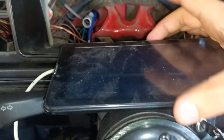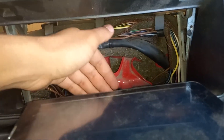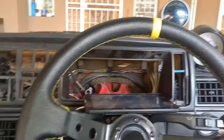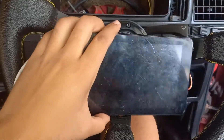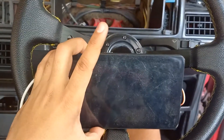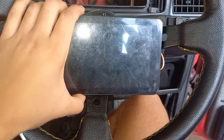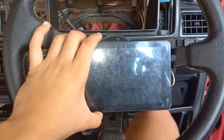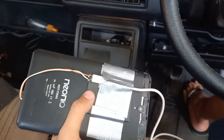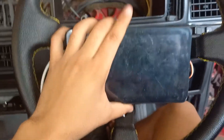It fits over the tablet really tight — I'll show you that. I'm planning on screwing it in there and kicking it out at the bottom so it comes a little bit closer. The main power issue is that RealDash — the app you have to pay for to unlock all features — does have the ability to restart the app every time you switch on the car, every time the charger is plugged in, which is how I plan to handle startup. I'm going to try using a bigger battery than what's in here because this one is fried and still too low on amp-hours, so I'll mount a bigger amp-hour battery back there out of sight.